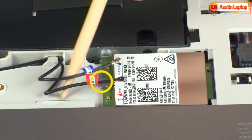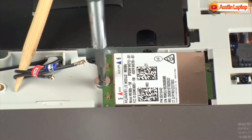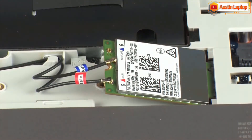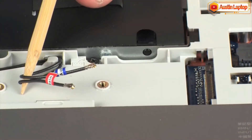Remove the 2 mm P1 Phillips-head screw that secures the wireless WAN module to the base enclosure and allow it to release to the spring tension position. Grasp the wireless WAN module by the edges and pull gently to remove it.